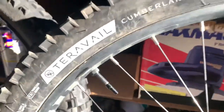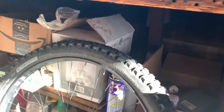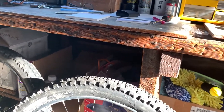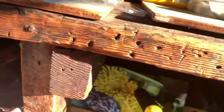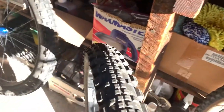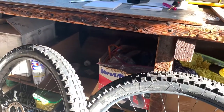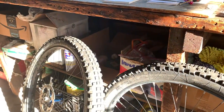When you go to a big fat tire in this plus format, you'll notice it's a real wide WTB rim with a 45 millimeter internal width. When you go to those big wide rims — 40, 45, 50 millimeter internal width — you can run super low tire pressure. It's still not squared off because it's a very sizable tire, and it still has a nice round profile. It allows you to run low pressure.